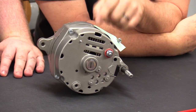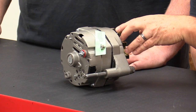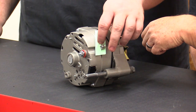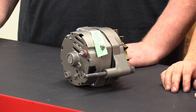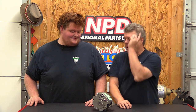This is what a lot of guys do — and there are reasons and advantages. What's funny is that a one-wire alternator is actually an industrial application, designed to be used in tractors and industrial apps. You've got one wire, that's all you need. The real basic reason for running a one-wire alternator is pretty — it cleans out the engine bay, you get rid of the external voltage regulator and all the wiring for it. That's the main reason to do this.